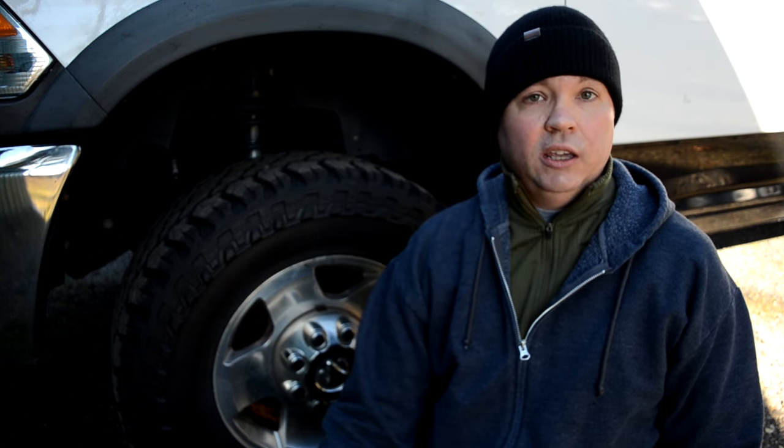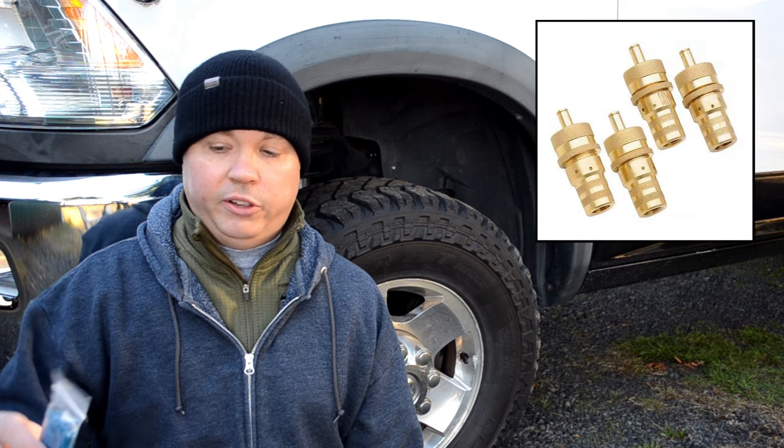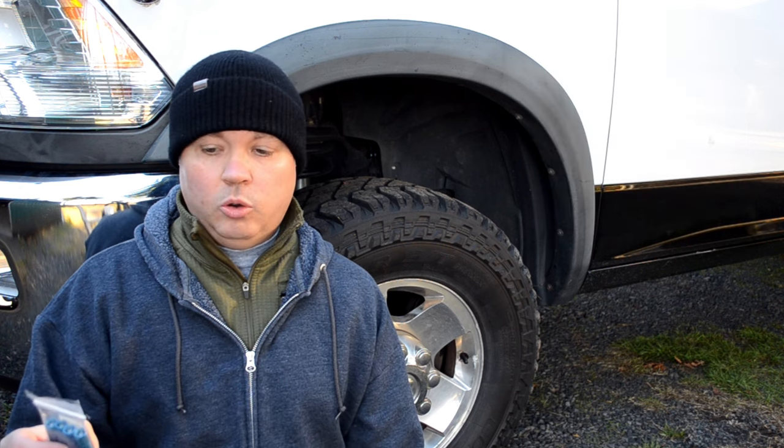With this truck it takes a really long time deflating tires individually from 60 to 20 psi, so I picked up a set of Trailhead deflators. I'm not sponsored — I bought these with my own money. I've used a set with my Jeeps for ten years, they're made in the USA, and they deflate faster and are far more accurate than the old Chinese mini brass-style deflators I had before. I've never seen tire pressure fluctuate more than plus or minus one psi.